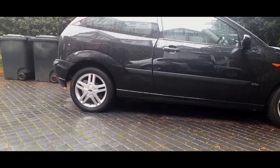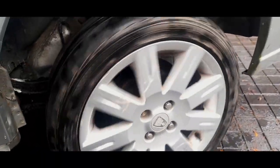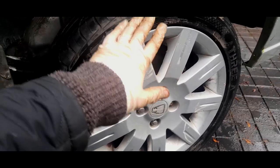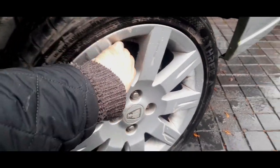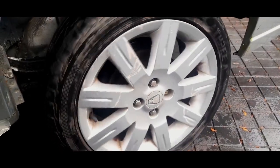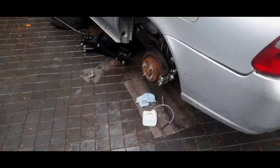It's different per model but same procedure - spin the wheels, click the handbrake up one at a time and see how it is. In general I think by five it's pretty much stopped, by six it's absolutely solid. On this wheel I'm hoping the other wheel is operating exactly the same. I am just going to back off the adjuster just a fraction as I think it's just a fraction too tight - and you can have too tight a handbrake. Next step: bleed the brakes.